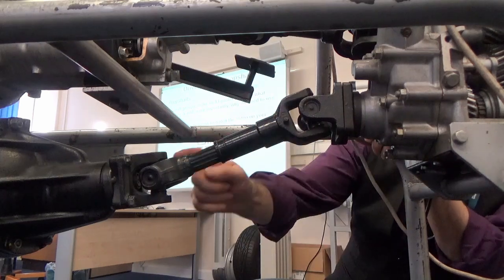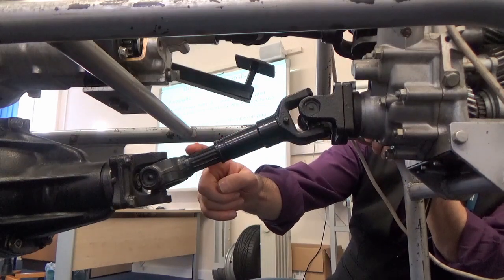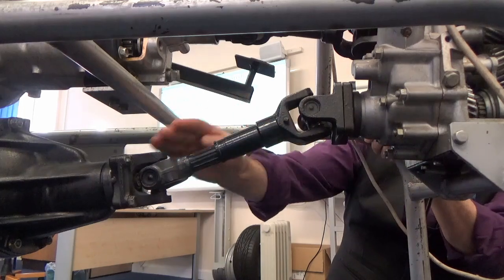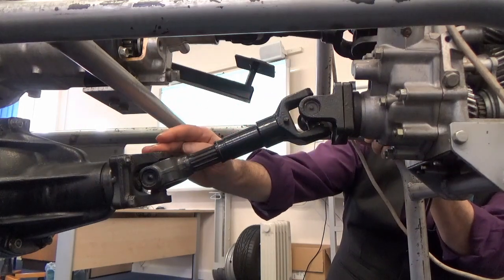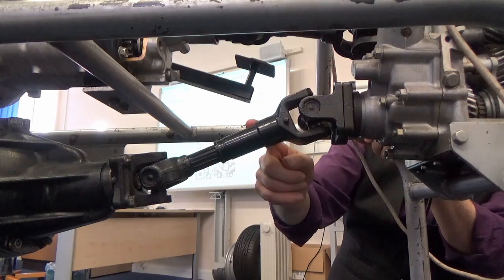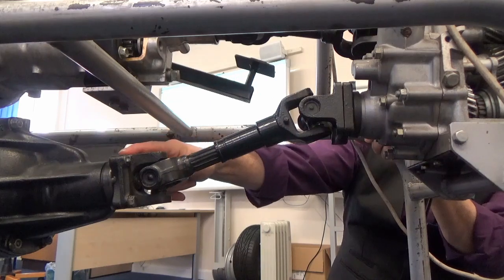Okay? Because these are not in line, there's no mirror image here. Now, as this one is, because these are actually the same way around, now what's happening is as this one turns the shaft fast, this one is trying to turn this shaft even faster.